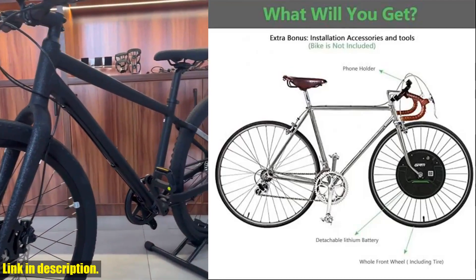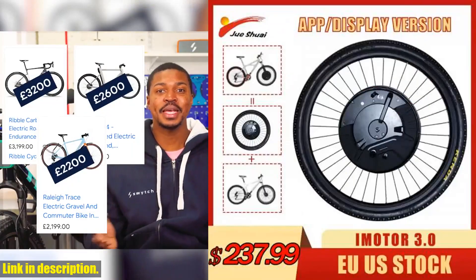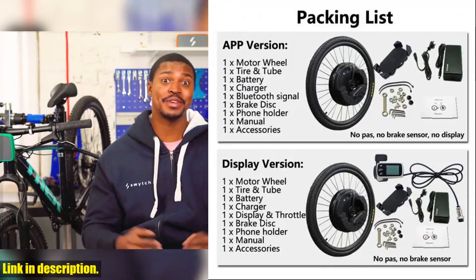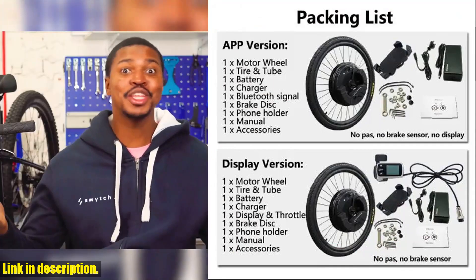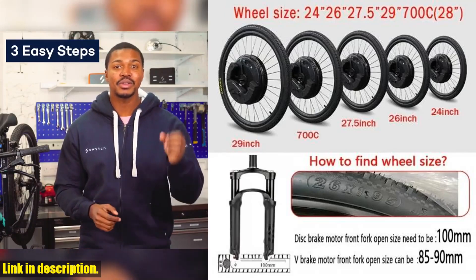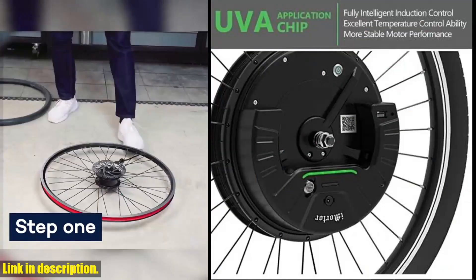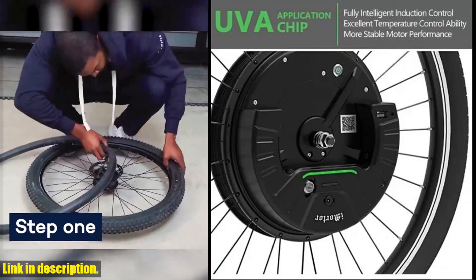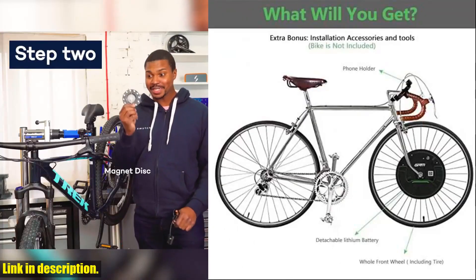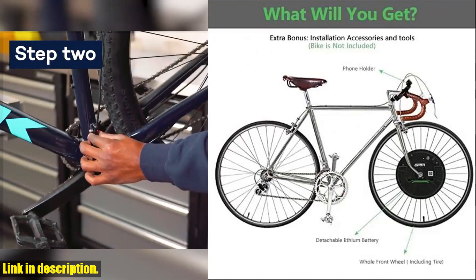Now, let's talk about power. This kit comes with a 350W brushless DC motor and a 36V / 270Wh / 7200mAh lithium-ion battery. With a max speed of 40 kilometers per hour and a range of 50 kilometers, you are definitely getting an electrifying boost to your ride. One of the great things about this kit is that it offers two options. Option A features a multi-functional LCD display and throttle, while option B is wireless and comes with a Bluetooth app. The app can show electricity, voltage, riding time, speed, mileage, and more. And the best part — you do not need to connect any wires with the app.